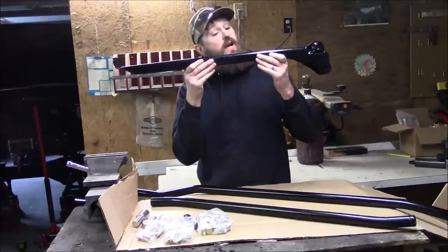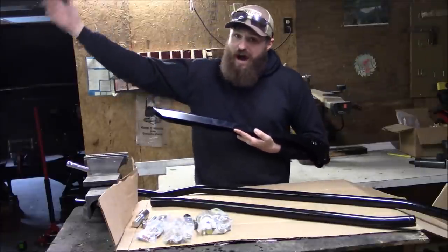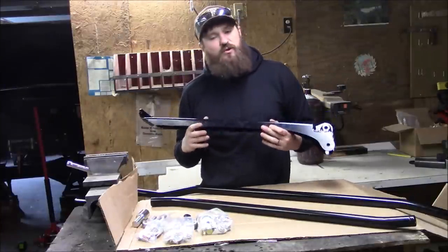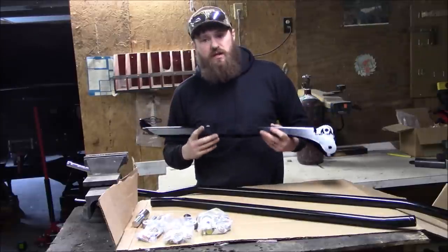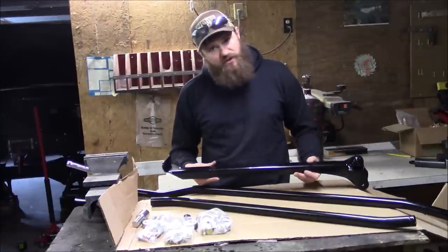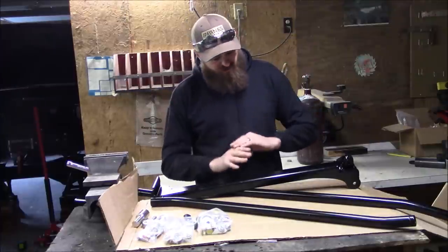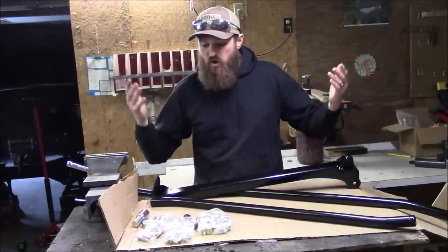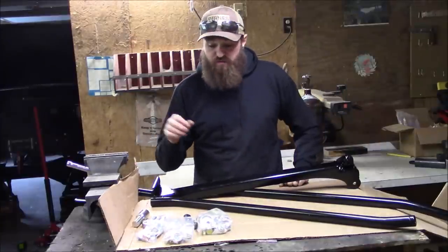This is attempting to correct bump steer by lowering that mounting location on the frame side and dropping that track bar back down a little bit more parallel. Not only that, this spans across the entire vehicle and mounts up to the opposite side uniframe channel, which is really important because when you're adding bigger wheels, tires, and a lift, it puts a lot of stress on that track bar. These are a unibody vehicle and the track bars have been known to crack or rip the bracket right off. This is going to significantly make that whole setup stronger. Iron Rock Off-Road provides really detailed instructions with this kit, so we're going to jump right in and get it installed.